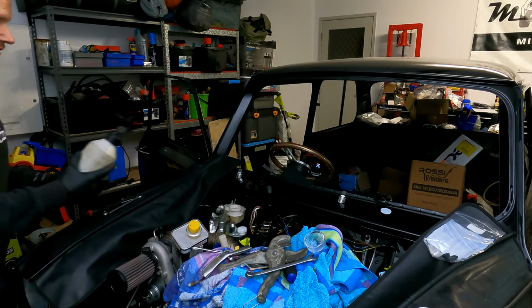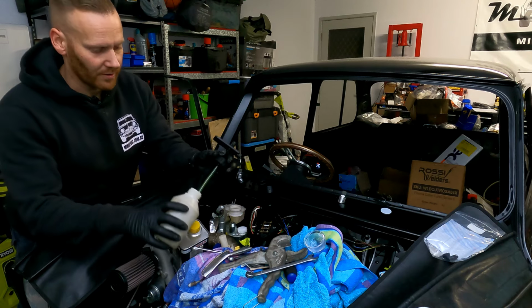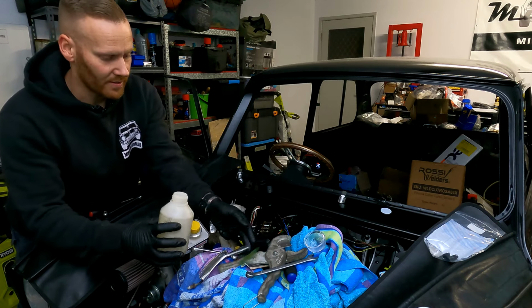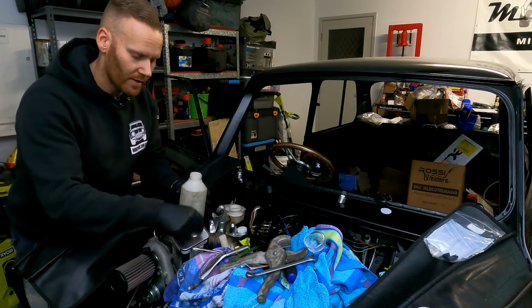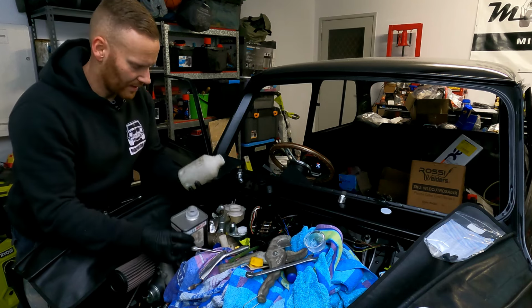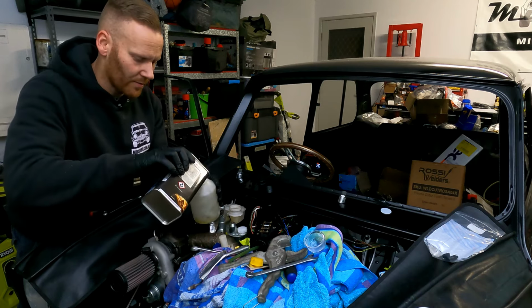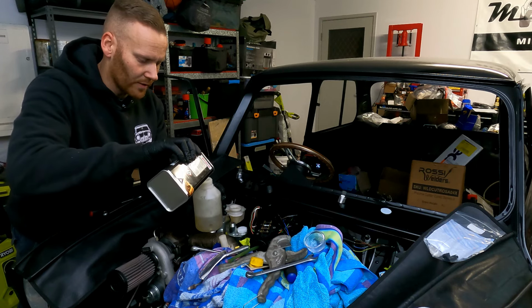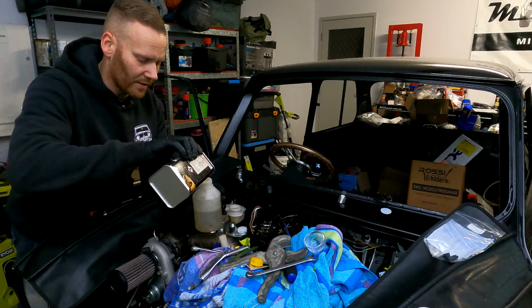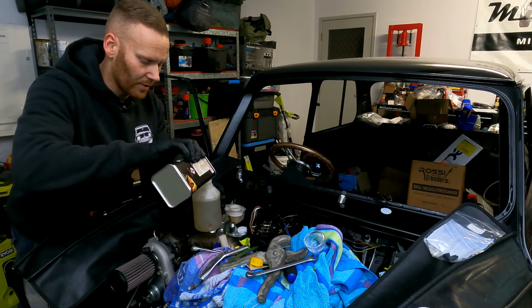Right, so in all my years of being a mechanic, this has probably been one of the best tools that I've ever bought. This is the automatic refiller tool. I bought this from Snap-on, I think. Yeah, it's a Blue Point one. Pretty much you just fill it up as much as you need. And then you put the lid on it. It's got a pipe that goes down on the inside. Make sure you don't overfill it because then it won't bleed properly.